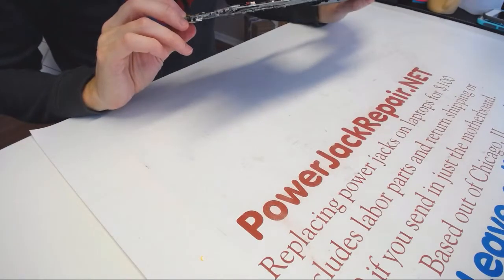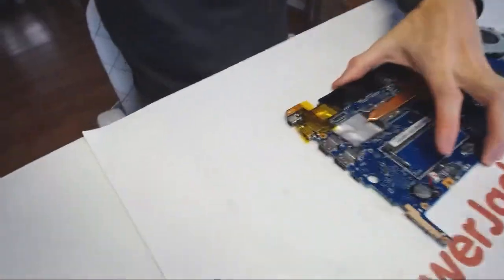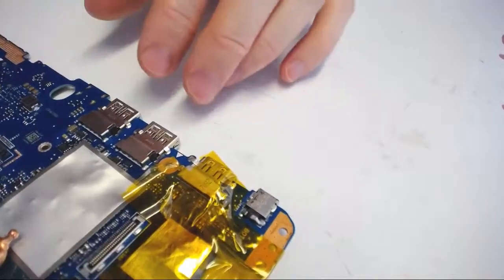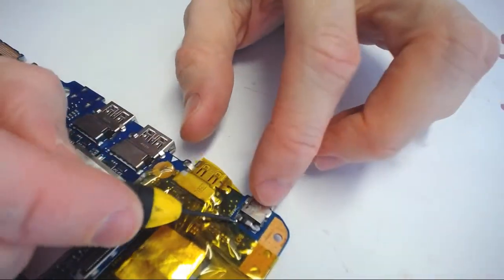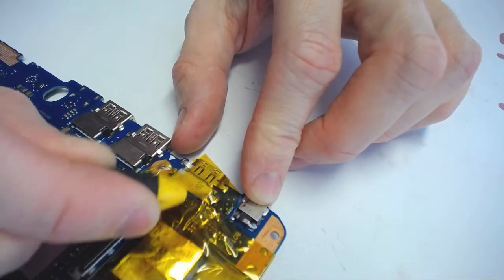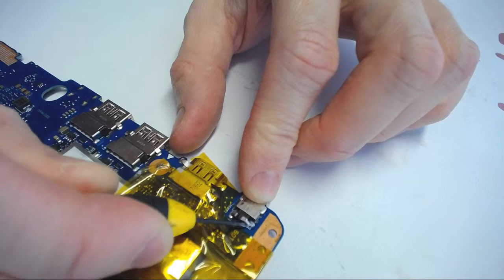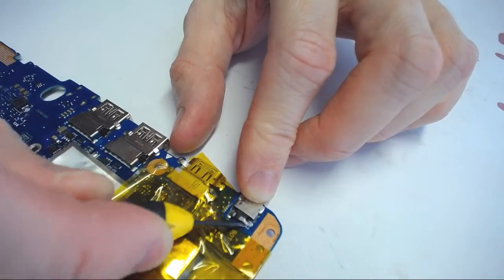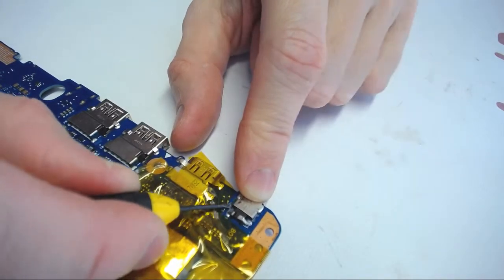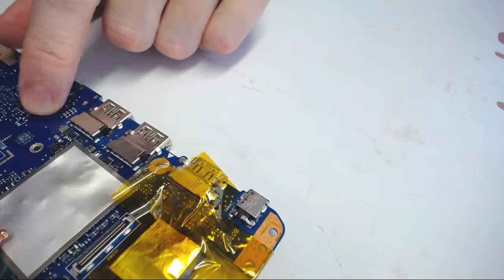If it's your laptop, you might not insulate it. Let me show you a bit closer — I should have shown it to you without the Kapton Tape. This right here should not be sticking out like this. This is supposed to be the part that's soldered to the motherboard and going through it. This part still moves — you see. But this part should be soldered directly to the motherboard right here. So that's your problem right there. Bad job.